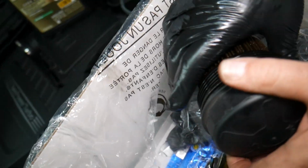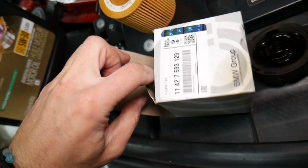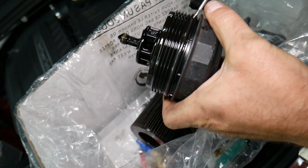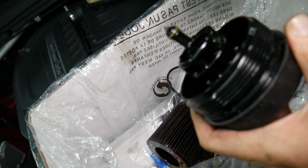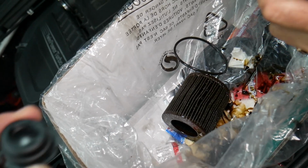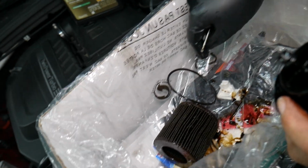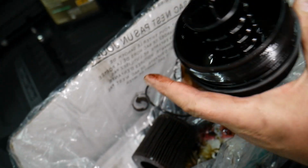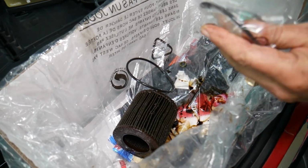Quite dirty oil. I think it's at close to 10,000 miles. Okay, we pulled it out. That's great. Now, here, guys, the new filter. I will put information in the description of the video below where you can get them from. But it's a very affordable price, comes with all the necessary things here for the repair, guys. So even if you have the 4-cylinder engine or you have the S drive, the one that doesn't have the front wheel drive, you're going to have a plastic drain plug like this one with a hex key. If you have the X drive, all-wheel drive, you have the aluminum plug like the one we removed, because we have an aluminum oil pan, and you have to replace that washer there as well. So let's go ahead. I'm going to pass them here and we will install the new ones now.